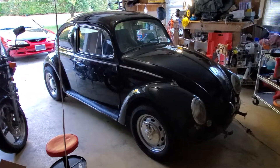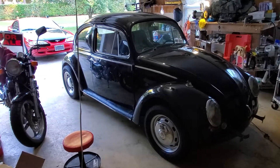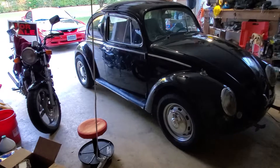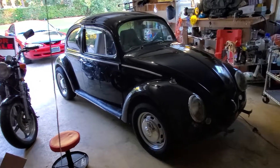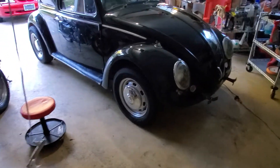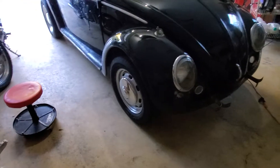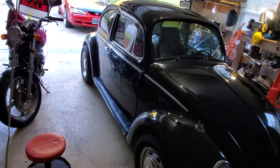The progress right now — I've spent the entire day, hours and hours and hours, compounding this vehicle some more, trying to pick out trouble spots and improve those as best I could. I have completely done compounding it. There are some spots where there's just not enough paint according to the paint thickness gauge, or the paint is damaged and cannot be improved any more, but overall I'm fairly pleased with it.